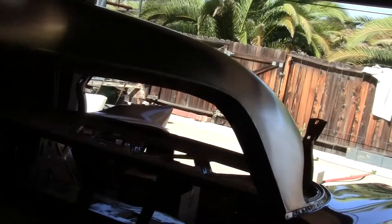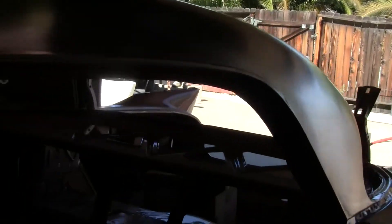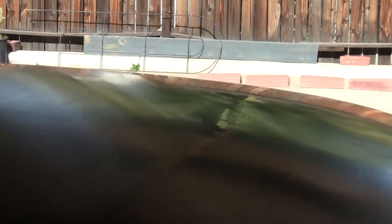Let's talk about this hammer stuff here. This isn't the biggest problem, although again it is a major problem. Can you see all those hammer marks? There's a whole bunch of hammer marks here. Somebody has been helping me — you can't see it from that angle. It's way high, it's stretched. About a good 24 inches of the roof has been hammered, and they stopped right where the reinforcement rib is. Now it's high here and low here. So that in and of itself is a major fiasco.